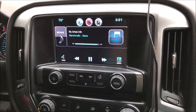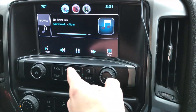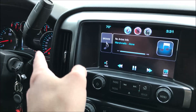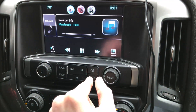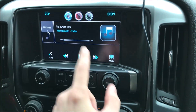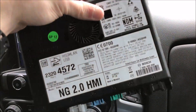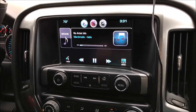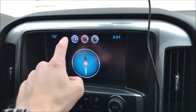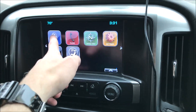When I was first doing this, I ordered the 8-inch screen and it came with another radio and another CD player. I plugged it in, nothing worked, and the audio was stuck — it said 'audio off.' So I put the factory radio and factory CD player back in and everything worked, but my screen did not light up. I learned that the IO4 box cannot function with this screen at all. You'll need the IO5 to run this screen, or if you get the IO6, that will allow navigation. I didn't go for navigation since I have GPS, but I still have every function of the touchscreen.